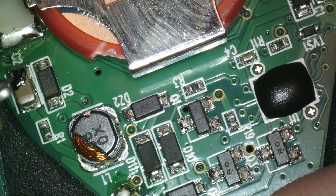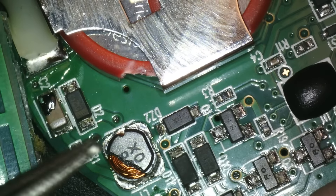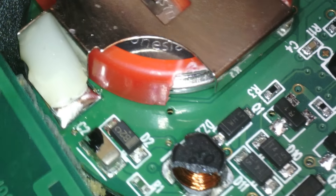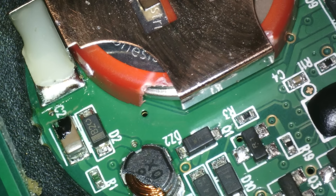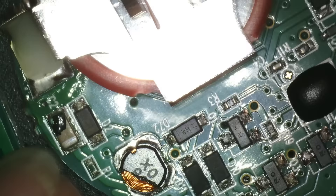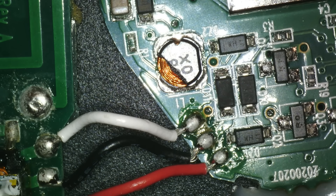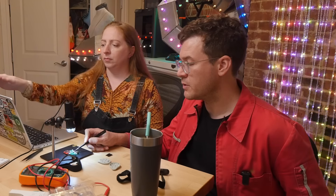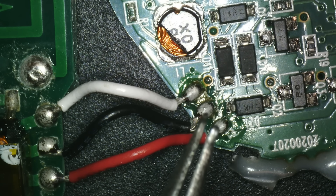What is this thing? That's just a capacitor — it just has some glue on it, it's not broken. This inductor could also be part of a boost-buck regulator to regulate the voltage. So this is going to be like a six-volt circuit — two three-volt batteries in series. It probably has something to switch that six volts down to a regulated 3.3 or five-volt rail, and then whatever it is to generate the zappy output.